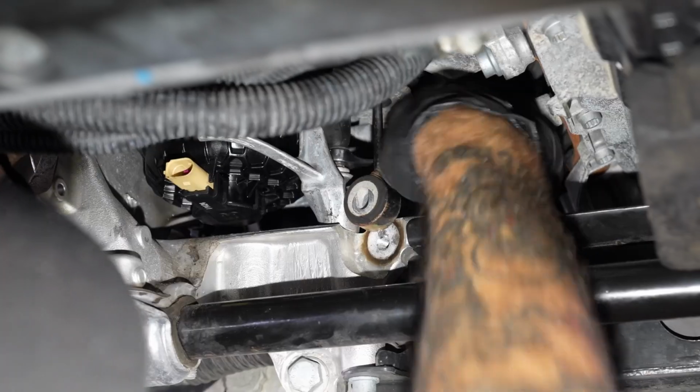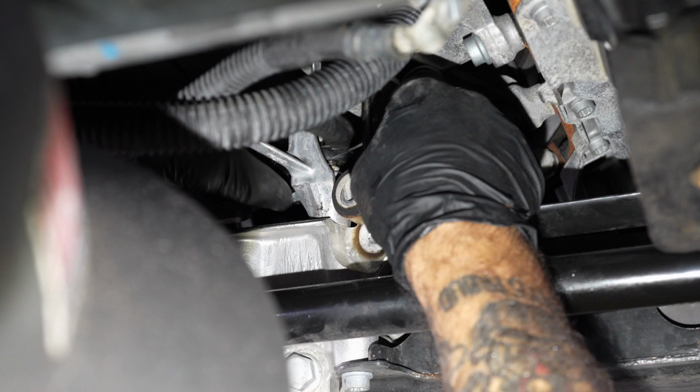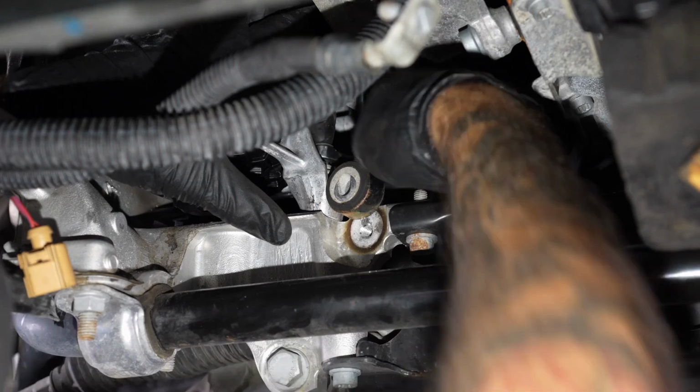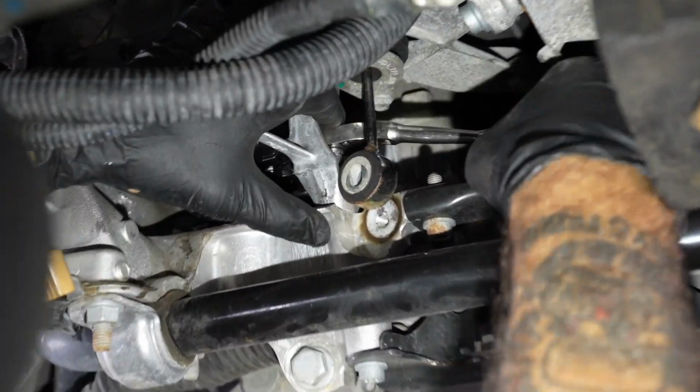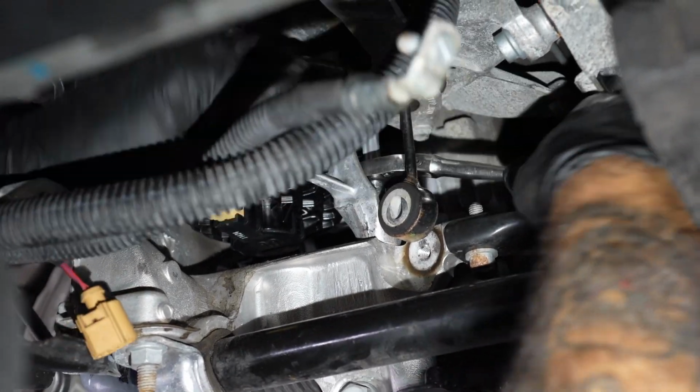Okay. Same thing, send it home with the half cut. You want everything going in nice and easy, like that's how you know it's going right. If you gotta fight these bolts in, reevaluate. Probably doing a shit job. Yeah, something's out of whack. Snug her down. Okay, let's get our quarter in there with the actual handle on it that we can put some torque on. Snug her down, that's it.